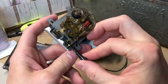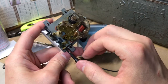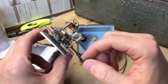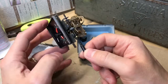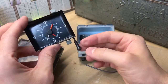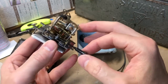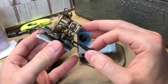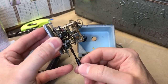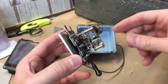There's a spring here to hold the pin in place. For me, I just left mine in there — I have the pin somewhere but I just use the fuse to set the clock whenever I need to. You may have the same issue; if you do, you can try to fix the pin and spring by remounting it and taking the clock apart, or just leave it in place. That's how the set mechanism works for the original analog clock — thanks for watching.